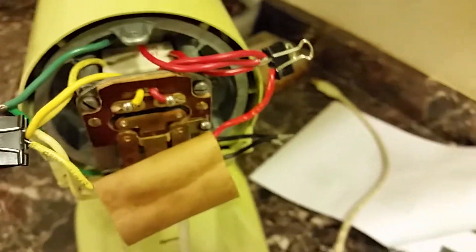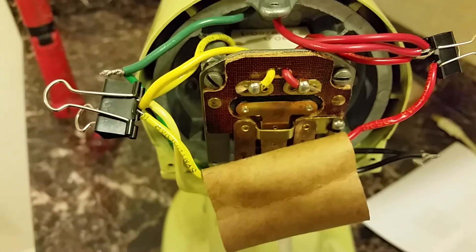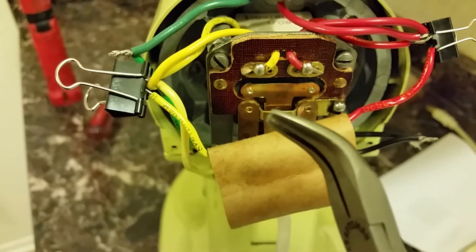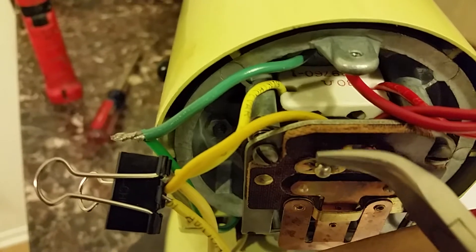So in operation, I'm going to run it at low speed. You may not be able to hear what I'm doing because of the noise. I'm going to short those two terminals together with this — and it'll show you that once you do that, all this governor stuff is no longer in play. It just runs according to being directly across the line. So, speed number one — and then I'm going to short those together.